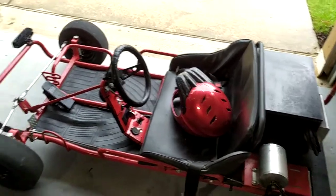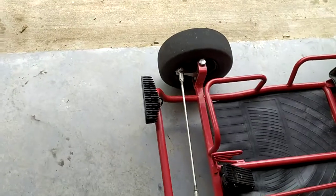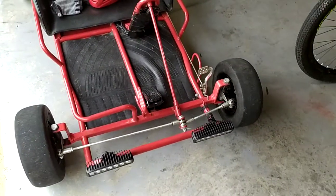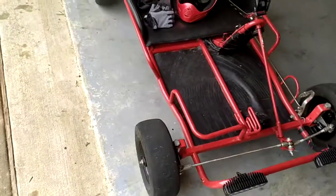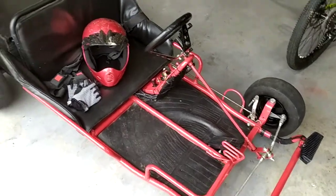So in closing, I'm so smart I'm stupid — I didn't even bother to see if the throttle pedal was set properly. Other than cutting a chunk out with the angle grinder, I set it back a quarter inch, and folks, that is why we're getting over 40 miles an hour.